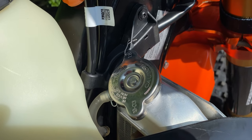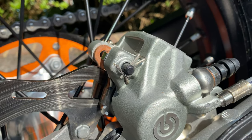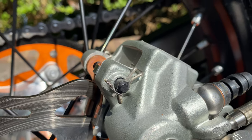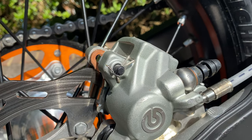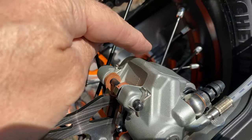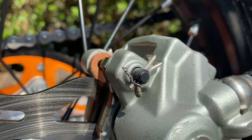Not for everybody, but for racers who've had this happen before — good idea. Same thing here on the brake pins: just to make sure that nothing knocks that brake pin off, put a tiny bit of lock wire on the back of the brake pin to stop the two ends from opening up. If that pin comes off and through some unlucky situation the next pin comes off too, your brake pin can come out. We do the same thing on the front brake, but somebody asked me to show how that's done, so there you go.